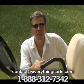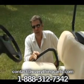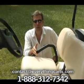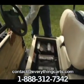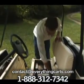When installing accessories, just about all accessories are 12 volts, and that could create a problem on electric carts. Gas carts, it's a piece of cake — you just hook it up directly to your battery, because all your gas carts are 12 volt sources. This right here is a Club Car 48 volt. If you have a 48 volt, then you're definitely going to need a reducer.